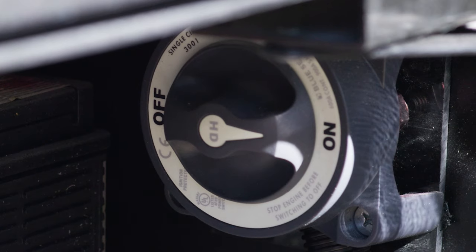All right, so we're inside. We're ready to set up camp. This is how you put your jacks down. You want to make sure that your engine is on — turn the key, just like starting a car, it fires up. Right over here is your air dump switch — put it to lower and let all the air out of your suspension. This is going to lower you three to four inches closer to the ground so when you put your jacks down and you're going in and out of your coach, you don't have a giant step up. Let the airbags drain — you'll know when they're done because it will stop whistling. Make sure your parking brake is on — that's taking the yellow handle and pulling it towards you — and that you are in neutral. Over here is your one-touch leveling jacks: you hit the on button and hit auto. The jacks will come down and automatically level your coach.